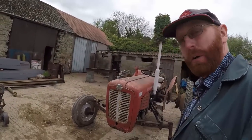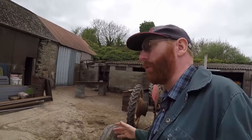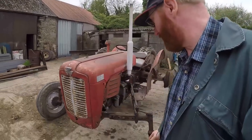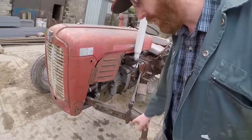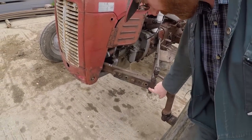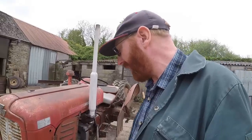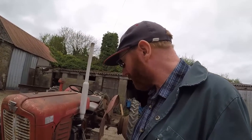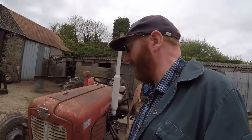All set out nice and wide. As I was saying, so much different to the 550. When we did this side, it was actually a bit more tricky — last year this bolt that runs down through the tie rod was seized in and we had to heat it up. I thought this time it would be all right, but it was stuck again. You can see we've greased it up this time, so this side did take a little bit longer, but hopefully next year, now it's got some grease on it, it should come out nice and easy.